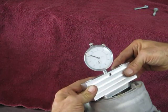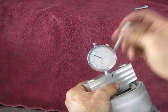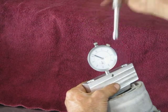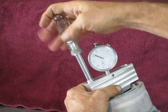Now we put the tool down in here and it rests in there on the bore. We put a couple of head bolts in here, just kind of snug them up a little bit, so the tool is resting in there on the recess in the bore.